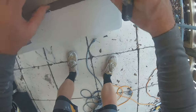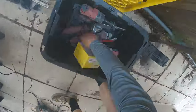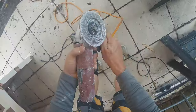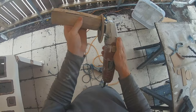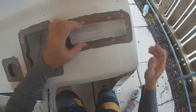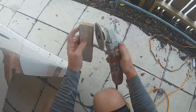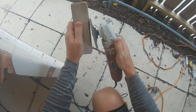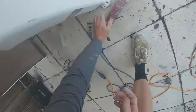I wanted to make sure I got a very tight fit on these pieces so I didn't have to worry about bracing them in place. But as I cut a couple of them, I actually cut the blank filler pieces a little too small and ended up having to hold them up with some brackets until I was able to put some glass on to hold them into place. I'm using a flap disc on my four-and-a-half inch grinder, taking off a little by little until I got the fit I wanted and it made a press fit to hold itself in place.